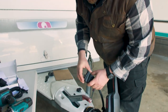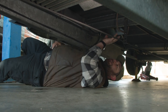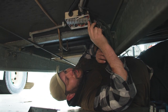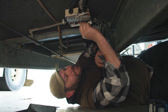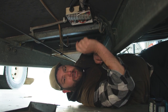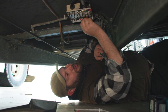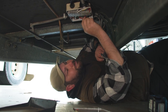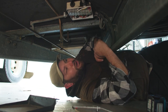The best thing to do is track back all your auxiliary wires from the auxiliary plug up the front. If you're lucky, your caravan will have a junction box where all the wires meet. I've got a terminal bridge here which lets me plug straight in — there are a few spare terminals. If you don't have one, cut the wires you need and solder them back together, or use crimping terminals with heat shrink. The red wire is for stop lights, the blue wire is for electric brakes, and the brown wire is for park lights. That's all the wiring — simple as.